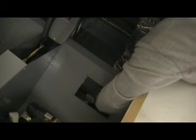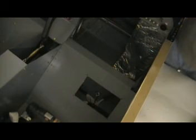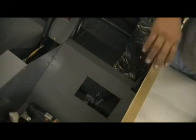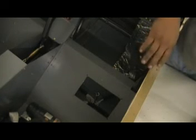What's funny is that bolt right there, I can push it in and out with my fingers. Whenever I put a wing on, the way I do it is I get the wing to where it has no stress whatsoever on the spar. So I can push the bolts in and out with my hands. And then I tighten them up.